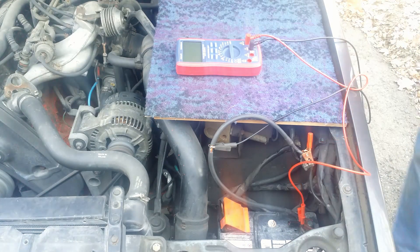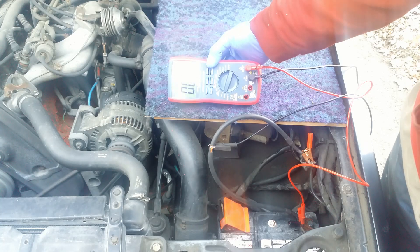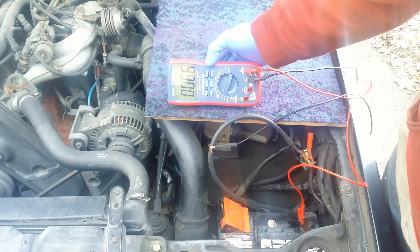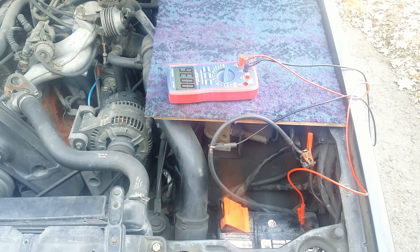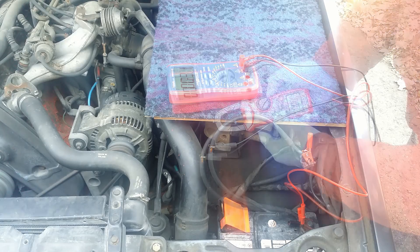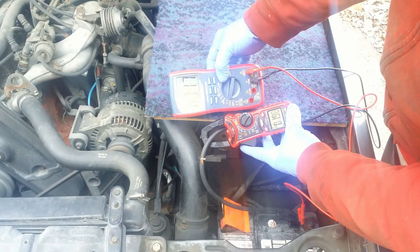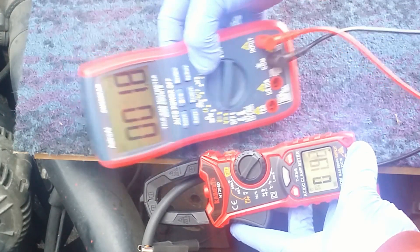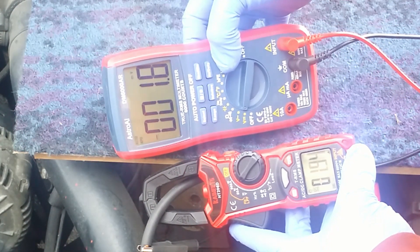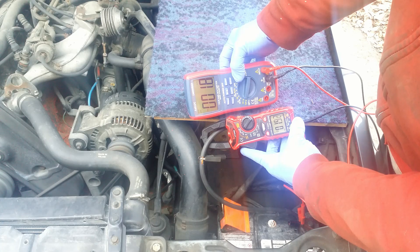I start the engine, turn on the meter, and I read 8.6, 7.6, 7, 6.6 millivolts. It goes down to around 3.5 millivolts and drops again. Now I have 1.8 millivolts and I use a clamp meter to measure the current. 1.8 millivolts is close enough to 1.9 amps. It looks like I can measure current with the voltmeter, and I will even trust the voltmeter more than the clamp meter, since the clamp meter can pick up some interference.